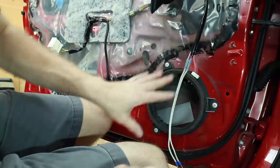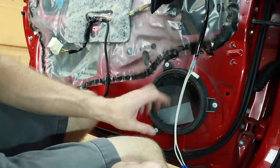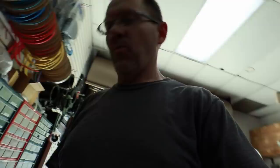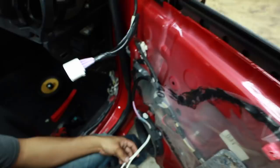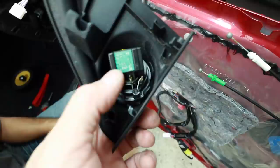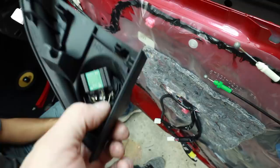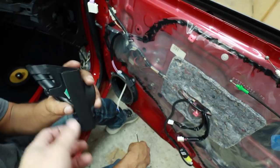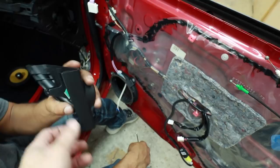To get these speakers out, you just have to drill the rivets. Metra does make an adapter that allows you to put the right speaker in the door without having to destroy the factory mount. Now that factory speaker is gone — if you ever wanted to sell this car or put it back to factory, he ain't doing it. Fernando thinks he's figured out why they ran their own wiring and had such a disastrous result — it has to do with the Toyota tweeter jumper. When you have this harness for the factory tweeter or factory mid-range up in the dash, inside is a jumper — parallel here and parallel here. It comes in, goes to the tweeter, and loops out back down to the mid-range. If you don't hook this back up or properly install your tweeter, that wire has no sound. His thought is that this wasn't connected, causing the issue, and that's why they decided to tear it all apart and run all new wiring instead of figuring out why it didn't work in the first place.